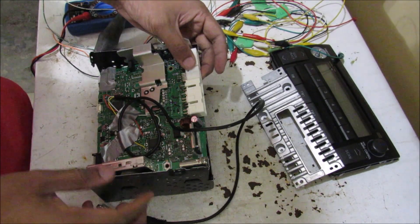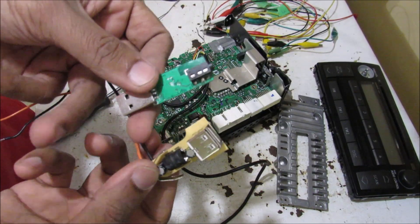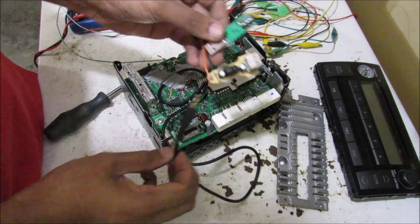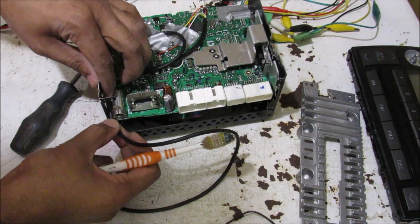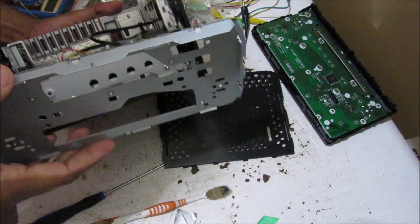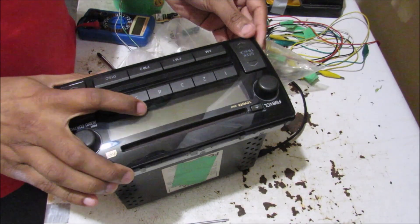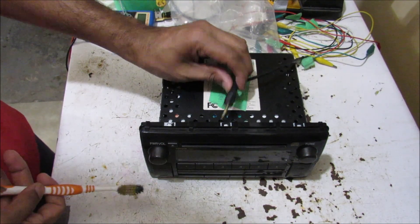With the auxiliary hack done, I'm placing the motherboard back into the shell and replacing all the screws. We could opt to have the power inverter and Bluetooth adapter installed inside the radio itself, but then you'd need to find a 12-volt power source in there — I tried it and almost fried my radio. I actually recommend routing the aux wire outside the radio and finding an external power source for the Bluetooth module. This aux wire routes neatly out the side of the antenna wire. Then I can place the back panel on, replace the heatsink screws, install the front panel pieces and front circuit board, and you should be left with the regular Toyota radio with an auxiliary line sticking out.